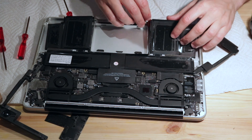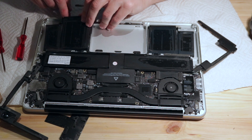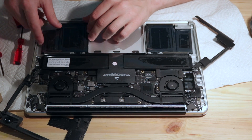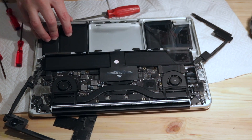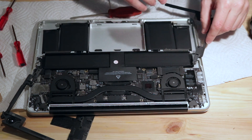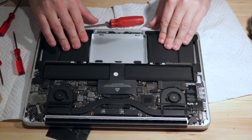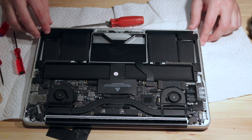Now I just need to remove these screwdrivers and get these other packs in their final position — or they will be glued down. Now I'm going to remove this back film, which is just a helpful film to keep everything positioned. I want to make sure the speaker cable is still clear. I can just push down a little bit on these battery packs to get the adhesive against the case so they don't rattle around. Reinstall the SSD — boom, just snaps into place. And now, speakers.